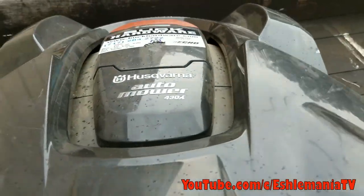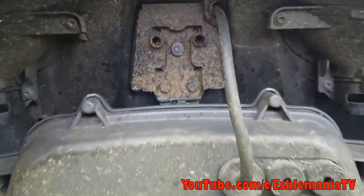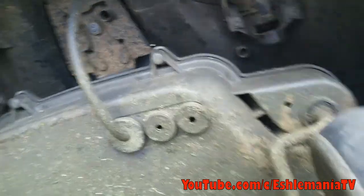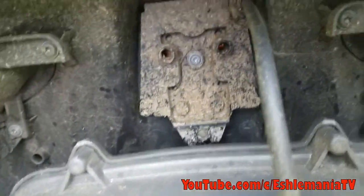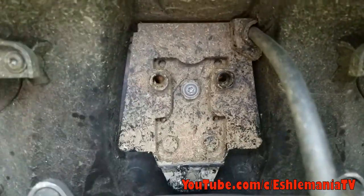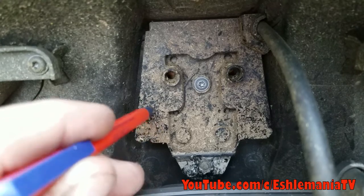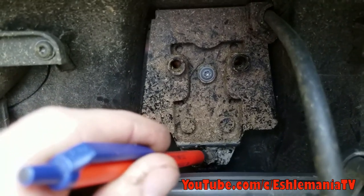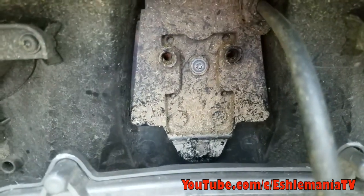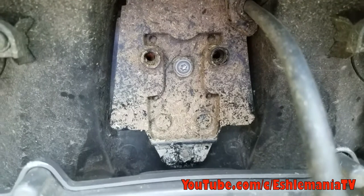and what is usually the problem on these 2016, early 2017 models, is right in here under your charging plates, directly under the nose of the machine where it goes into the charging station. This plate here, if it is black plastic, then there's a good chance that you lost this little magnet right here. This little barrel-shaped magnet will come out, it'll get lost, it'll get in there sideways. If it does, it's going to screw everything up.